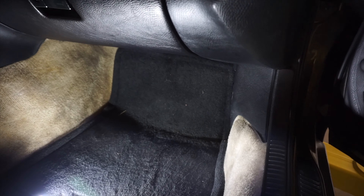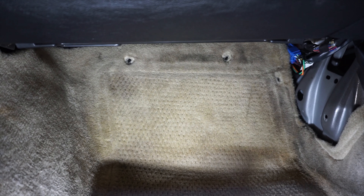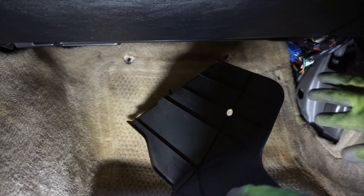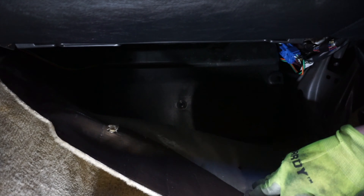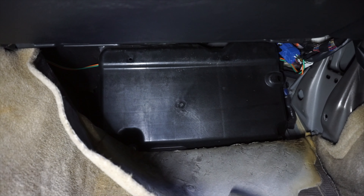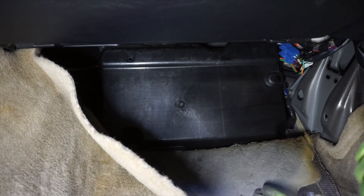Car's back down on the ground. I'm going to unplug the harness from the ECU, which is underneath the passenger side dash. There's a screw or two holding the kick panel on — there's a screw right where my finger is, so when you go to pull this side off the entire door sill needs to come out with it. It's pretty easy to get off, it just pops up. Underneath this panel is the ECU, held in by two 10 millimeter nuts along the bottom.